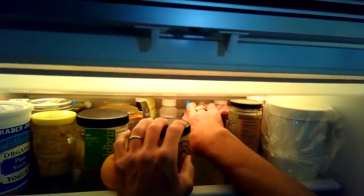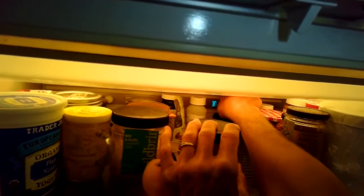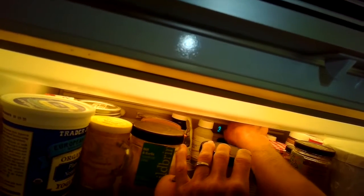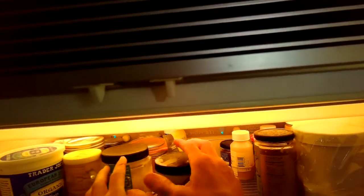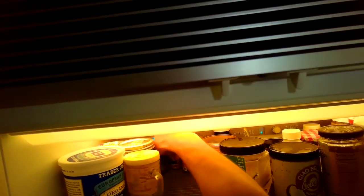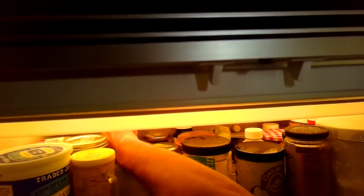First I'm going to turn the settings in the freezer and the fridge to their highest setting, and that'll turn off the compressor. You can also unplug it, or you can turn off the breaker. There's two controls in the back, and the one for the freezer, if you turn it to the highest setting for warmest, it'll turn off the compressor and the fans.